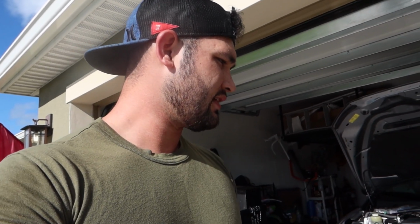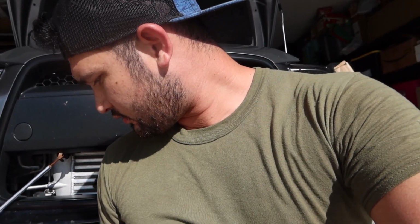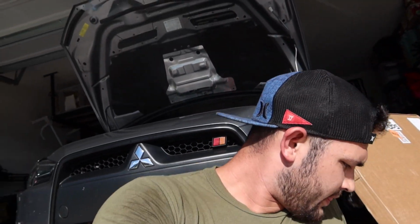But number one is make sure you check your oil pan bolts. A lot of mine were loose and were causing a little leak. I thought it was a gasket. So I sealed them up last time and everything seems to be kosher again. So let me go ahead and show you what I'm talking about. So these are going to be a 10mm and I believe that was a 14 or 12, I can't remember. Anyways, there's two different sizes of bolts down there, and let me just show you guys what I'm talking about.